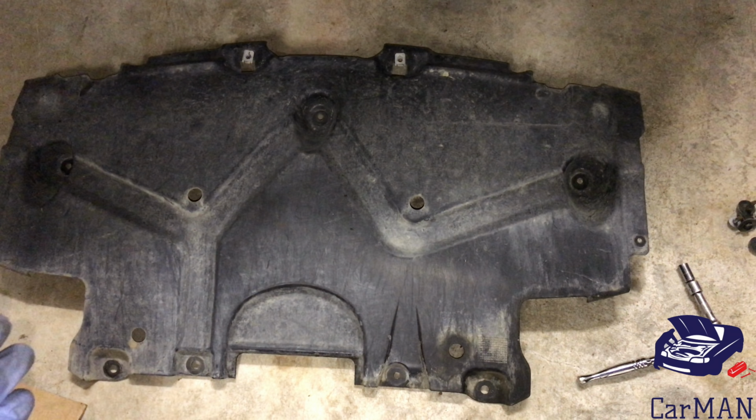The things we're going to be needing today is some Mobil 1 0W40 oil. Second is the oil filter, a ratchet with a 10mm socket and a 13mm socket, and also an extension, an oil filter housing remover. The one that I'm using is sort of universal. It's going to clamp on. There's a lot of different types. There's a plier type and there's also the cap on type, but I'm going with this one today. And also a jack.